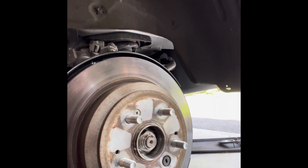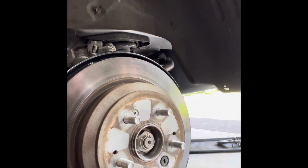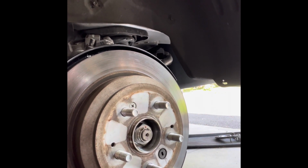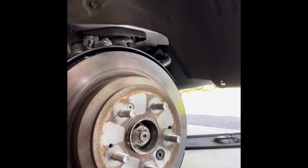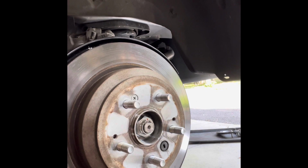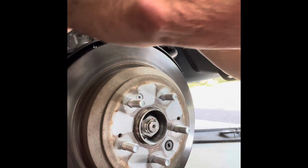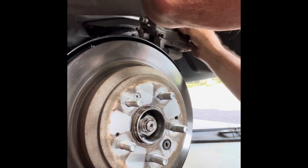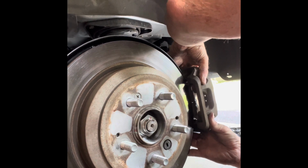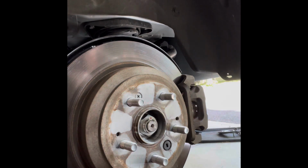Okay, folks, got the axle nut torqued and crushed it back down. Good to go there. Almost done here, so hang on. Next step, I'm gonna put on the brake caliper with the 2 bolts. There it is, undisturbed. Right back in there, like that.